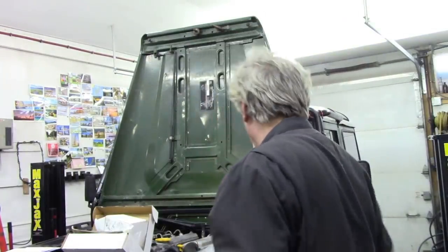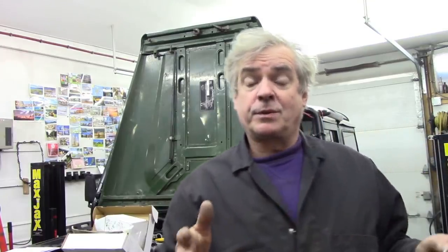I've fitted them before and I've had to replace them under warranty so many times. I just found this one on the shelf by chance. So let's have a look at the genuine one. This was bought by the customer because this is a North American spec 90, and instead of having the cable on the right-hand side, on left-hand drive vehicles they put the air conditioning unit there, so they shifted the cable across towards the driver on the left-hand side, meaning it should be a bit longer.